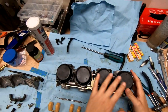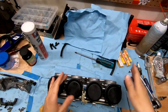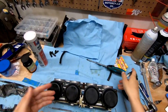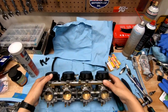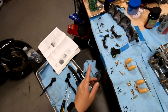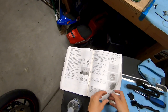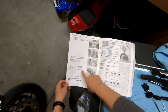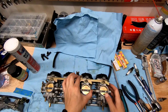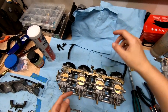I stopped the video for the day but finished putting together the tops. A little heat from the heat gun on the diaphragm rubber and it slid right into place. I got all the tops on and tightened down — you don't have to do them super snug since there's not a lot of pressure on them. I also tightened the two long bar screws. The torque setting was about 1.5 foot-pounds — almost nothing, so just get them tightened down. Same with the choke bar screws — just make sure it's pulling each actuator.